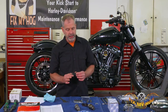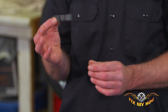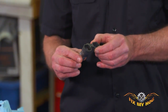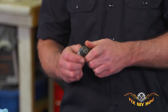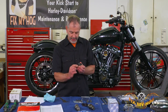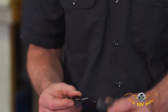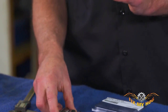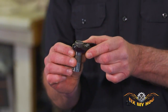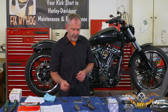On the M8s they came up with this Teflon or plastic little lifter guide, and really what it does is it keeps the lifter from rotating. It sits on the motorcycle going up and down in there. S&S saw that was going to be an issue, so they came up with billet aluminum guides. Now it's not going to wear out — it's just a nice little upgrade we're recommending you do when you're in there. Basically free labor at that point.